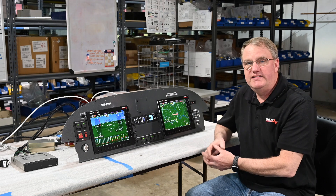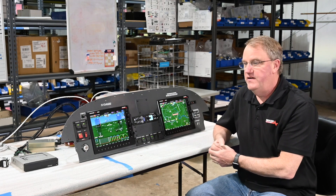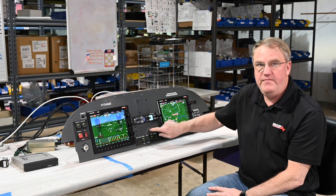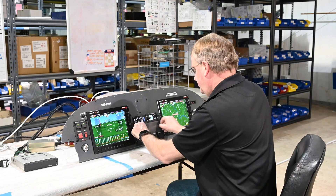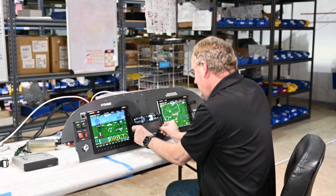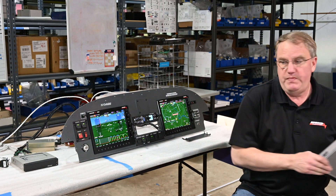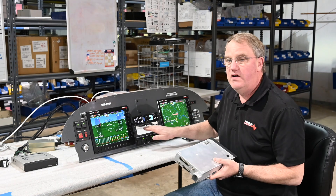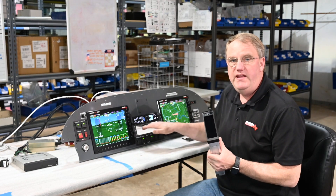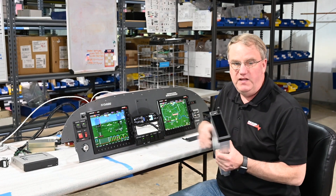So I think we've shown how you can add a second MFD. The next thing — let's say you'd want to do — is add an IFR navigator. That is extremely easy. We've got the pre-made plates; we'll just unscrew the plate and take it out. In this case this panel was cut for a Garmin GNC 355. We have the tray pre-made with a harness that just plugs into the ACM. So the next step is just mount the tray and plug it in.